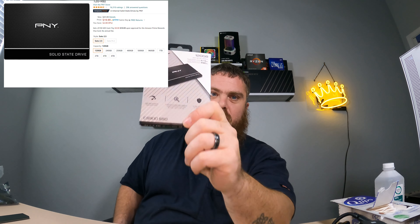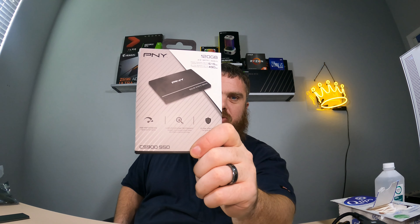If you're using a thumb drive as your boot drive for Hive OS, I've had two thumb drives fail, so I've replaced all the thumb drives across all my farms. Now I use 120GB SSDs. I keep one or two of these on hand — they're about $20 each. If one fails or goes down, I just reflash another one and I'm back to the races.